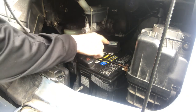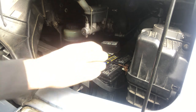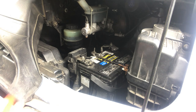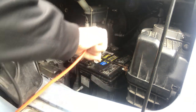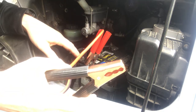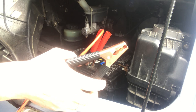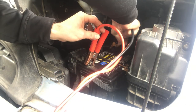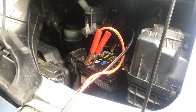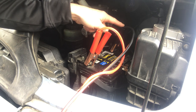Your battery has a positive and a negative terminal and it's going to look a little bit different for each vehicle. If you have covers over them, you're going to want to remove those or push those back so that you can get access to these terminals. You want to connect the positive connector first to somewhere on the terminal where it's going to get good clean contact. If your terminals have buildup of residue or different things on them that are going to hamper that connection, it is going to affect it. Now we have these connected — the red positive lead to the positive terminal and the negative or black to the negative terminal.